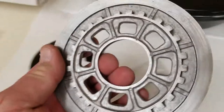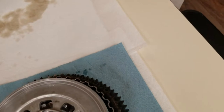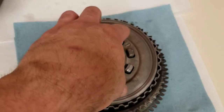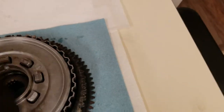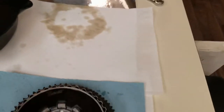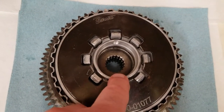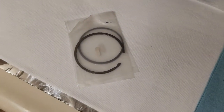Tonight I'm just going to take this — this is the pressure plate. It goes on top there. Then this spring will go here. And then what we would do after this is put the clutch release bearing in here with the adjuster screw, pop that on there, and get the retaining ring in there.